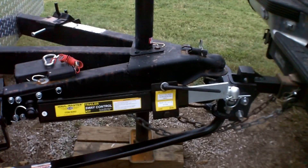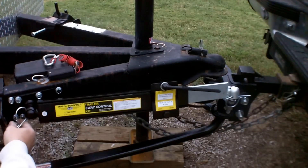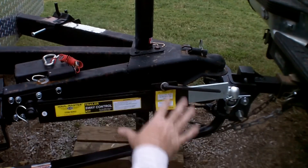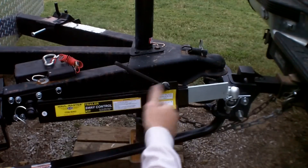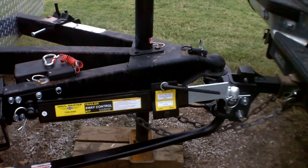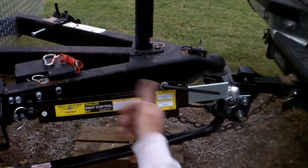Everything's been installed and locked in — it's looking good. I installed the plate here, and then from that point it's just a matter of setting it on, installing your clips, and there you go. At this stage, what I need to do is jackknife the trailer in both directions and make sure it doesn't disengage or come out, or lock up on this side or hit the trailer or do any damage. To test it out, you tighten this up nice and firm — about like that — take it out and drive it. If you're still having problems with sway, then you would loosen this and turn it in one quarter increments, then tighten it back up and test it again.